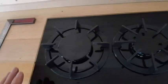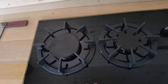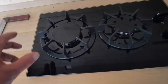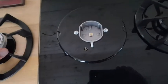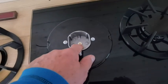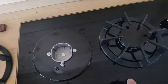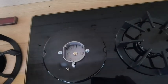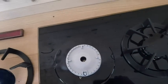The cooker is in but there's a bit of modification needed. When I bought it, it was listed as compatible for LPG but when it arrived it was set up for natural gas. What you have to do — it does come with the parts — is change the jets. They come with it. Then I think you also have to adjust the pressure coming in and then it'll run off LPG — liquid petroleum gas. I'll show you that in another video, or if the part comes today I'll cover it in this video.